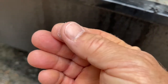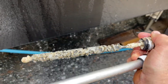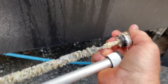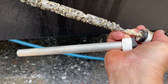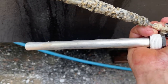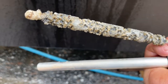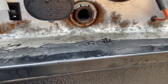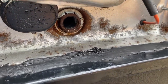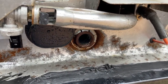The water's just about done draining and I wanted to give you a side-by-side comparison. Here's why we're changing it — that's what a new one looks like, nice and smooth. If you buy the actual Suburban brand anode rod, it's just a couple dollars more. They come with the Teflon tape already installed so you don't have to do anything. The threads are cleaned up — almost all the white stuff is gone. There's a little bit way back in there, but it's further back than the threads of this will actually touch, so I'm not worried. I got probably 90% of it out.